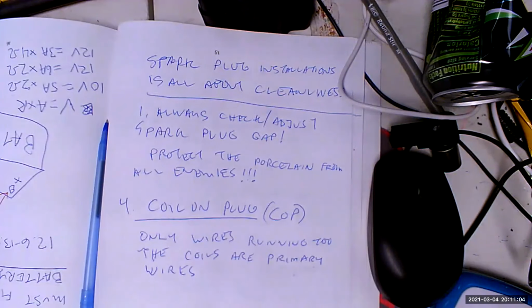No. For me, of course, you're going to ohm test them. Since I have an ultrasonic cleaner, I'm going to buy a kit with the O-rings and clean them out first. And whatever the trouble codes are telling me, what particular cylinder or misfire, that's the one injector I'm really going to focus on. I may replace that one.